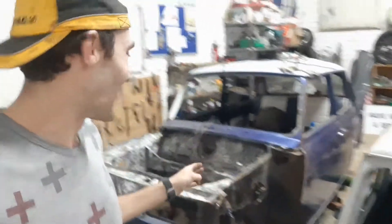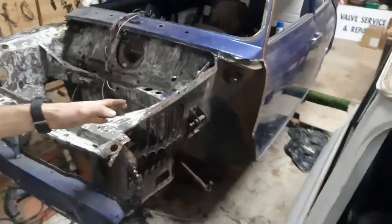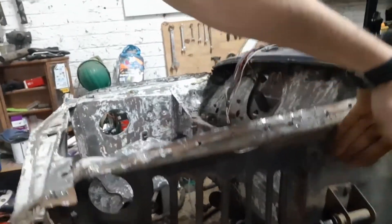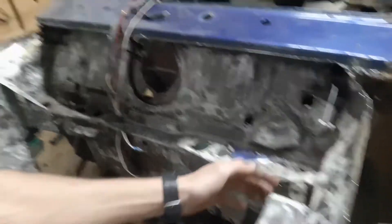Eventually we're getting to the last day on the chop. Today's the day — well, tonight's the night — it's getting the chop. We're going to come to the front of it about an inch away from the shock strut mount things, chop all the way in front of these braces here, pretty much right next to where the radiator is, and the same on this side. Getting the angle grinder out, getting the safety glasses on, hitting the time lapse, and let's chop it.